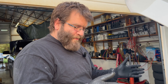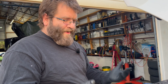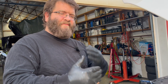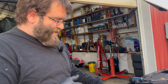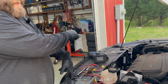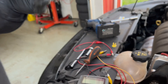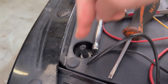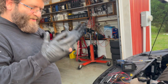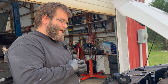We're going to prep the vehicle to do a parasitic draw test with the keyless remotes. You want to get them away from the vehicle because that can help keep computers alive. Also, this has a hood switch by itself — sometimes they're built into the latch. You'll make sure all your doors are closed so that way the car thinks it needs to go to sleep. If the car is not trying to go to sleep, you're obviously going to get a bad amperage draw reading.